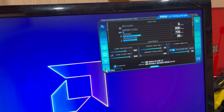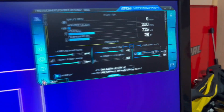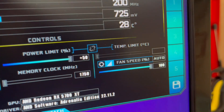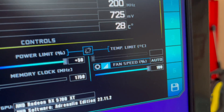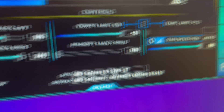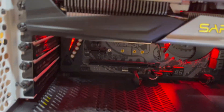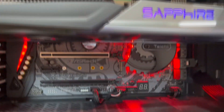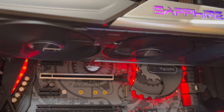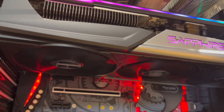So if you don't have a Sapphire card, or maybe you have a different manufacturer — AMD or an Nvidia card — something you can do is download MSI Afterburner. You'll have to enable custom fan control, then uncheck auto right there, and slide the fan slider all the way over to 100, then click Apply. This will probably be hard to pick up on, but the fans are just making a weird revving up and down kind of sound, and that's because that middle fan is just not functioning how it should be.